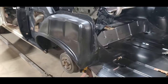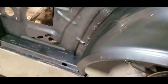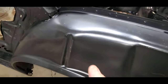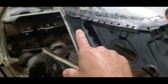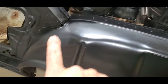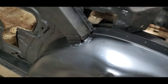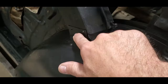As we come in here, you can see I've got it all welded up — this whole thing is welded all the way across and all the way down. But the problem is right here. This is your roof rail support that comes all the way down, ties into the wheelhouse, and then distributes the load across. This is super important — another area I find a lot of times when I cut cars apart, if this panel was replaced, people forget to weld this.